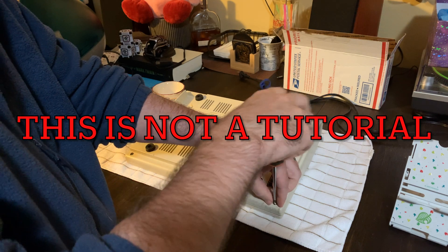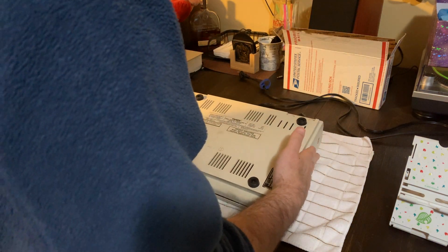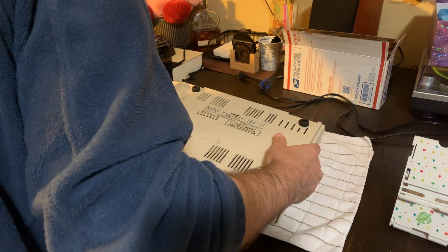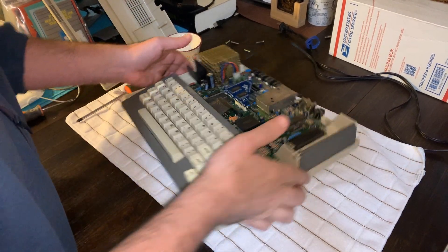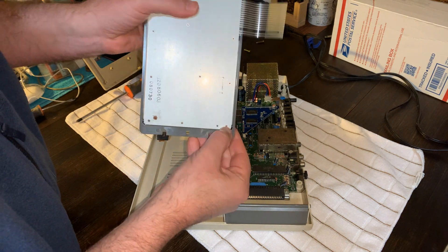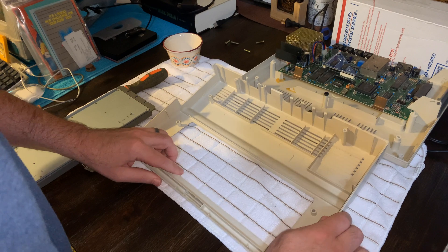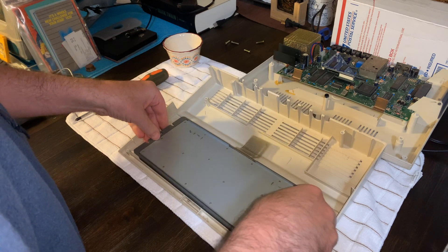The memory upgrade and this keyboard upgrade were super simple — some of the least complex upgrades I've ever had to do. The first thing is to open up the case, pull the top off, and remove the keyboard. Just pull that little ribbon — it comes out real easy, just wiggle it back and forth gently. For the most part it looked pretty good; the traces looked really good, so I don't know what was causing the issue — maybe something just dirty inside that mylar.